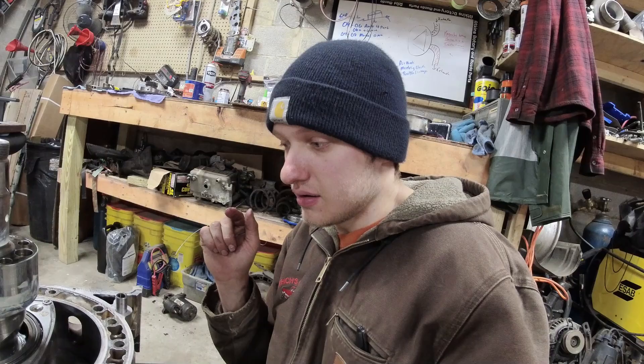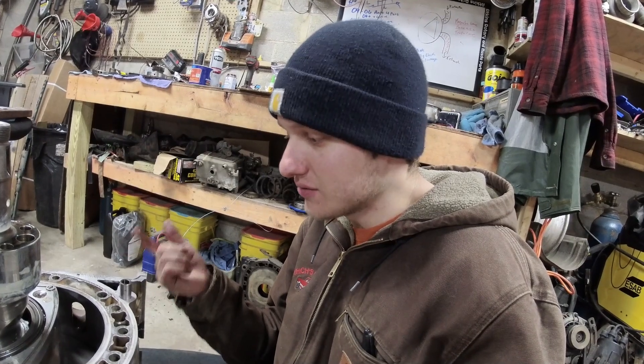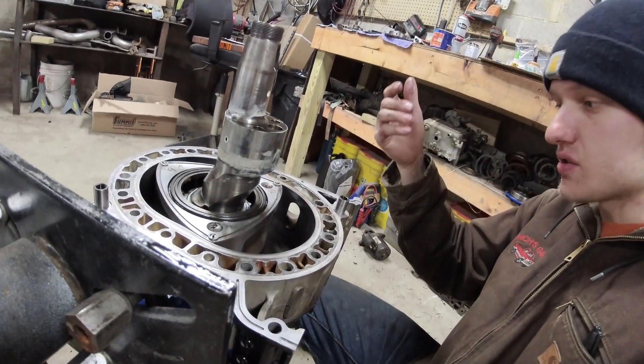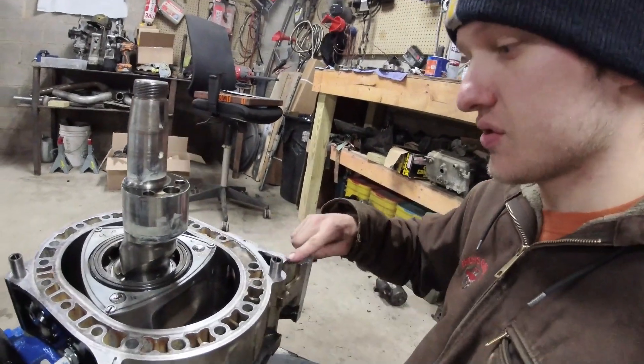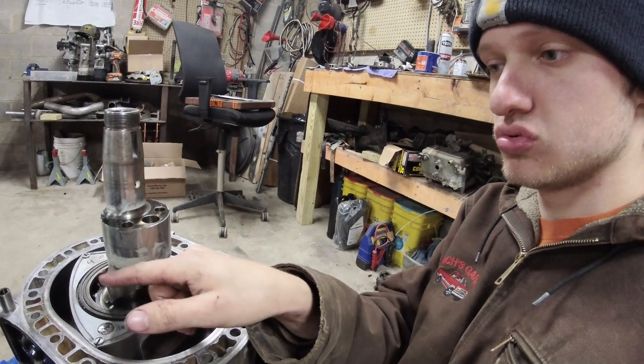They're glued down now and I'm still going to be very careful and check these once I get the center iron ready to go on. They definitely stay down way better with the glue. It is just a little more tedious. I think the control rings are in pretty good and I probably didn't need to do that, but we're being extra careful this time. I don't know that I'll glue them on the next one because that took an extra 30 to 45 minutes. So I've got to do my dowel o-ring, put the coolant seals in the center iron, and get the iron on.